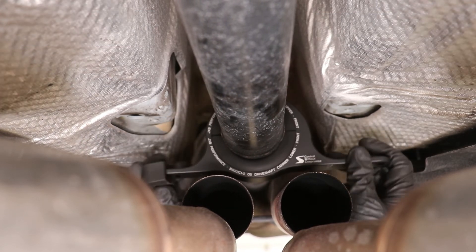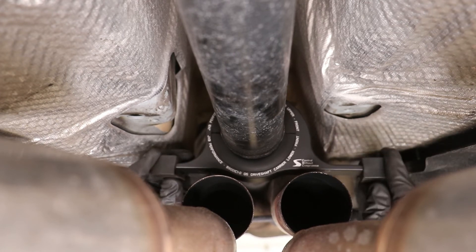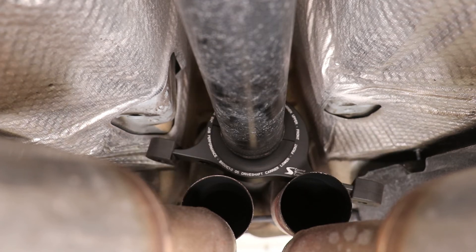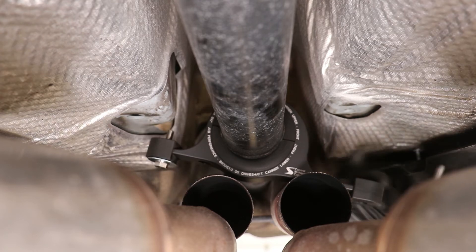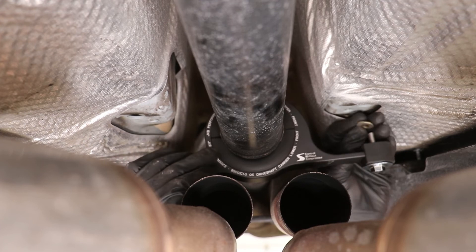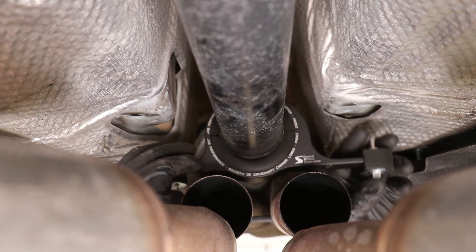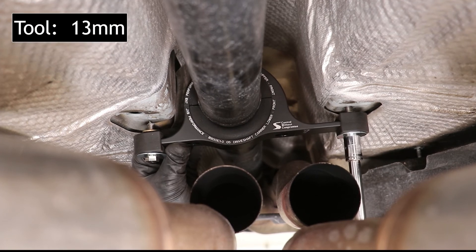Place an isolation damper over each foot. Place a bolt with the fender washer up through each foot, and place your small washers coming down from the top on each foot. Then bolt each foot up to the body of the car.